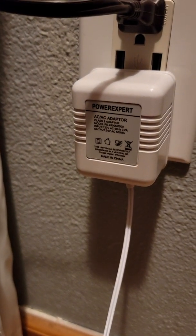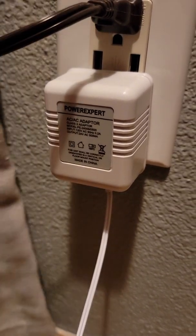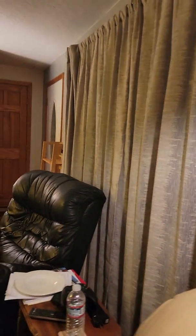The way you solve that — I'll try to put a link in the description — but you have to get one of these power adapters. This one's by Power Expert; it worked for me and produces 24 volts. Just keep in mind you're adding 17 to 24 when you're done, but this pellet stove didn't blow a fuse or anything, so don't worry about that.